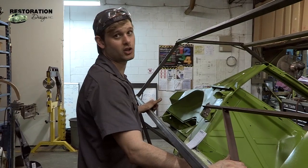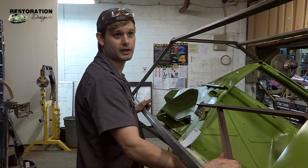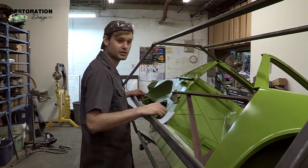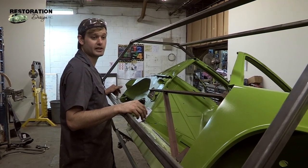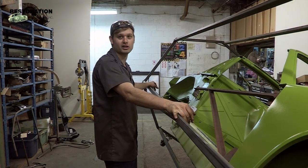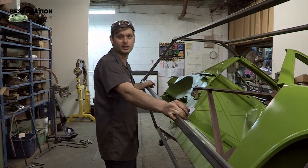The braces should be installed in the car before you cut out any structural sheet metal. To ensure that you have got your proper gaps, you can install your targa top just to make sure it comes on and off easily. Double check that all your dimensions are correct — I've put a link in the description box below where you can check all the factory dimensions.